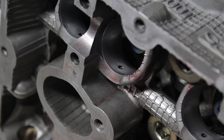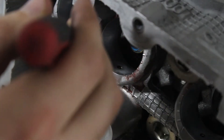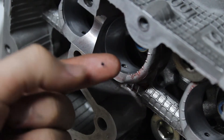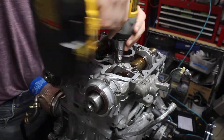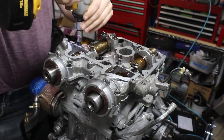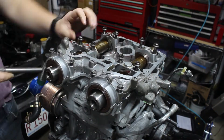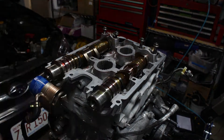When I was reassembling the other head, I noticed some grit in the oil passages. Upon closer inspection, I found out this was actually sandblasting grit. The machine shop had blasted my heads, which was great, but they didn't clean them properly. So apart came all the heads, and while I was at it, I noticed I had a sticking valve too. I brought them back to the machine shop, making sure to remind them of their mistakes.